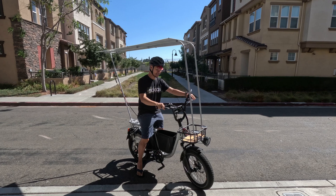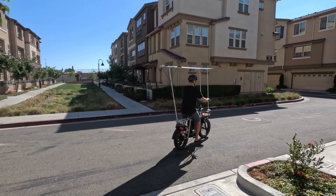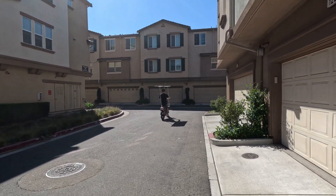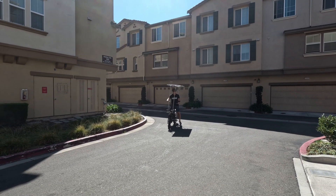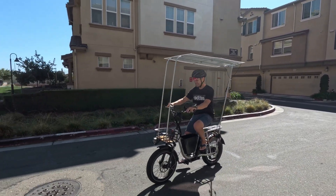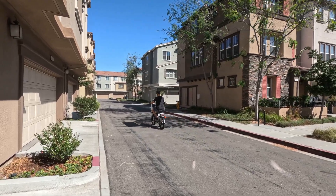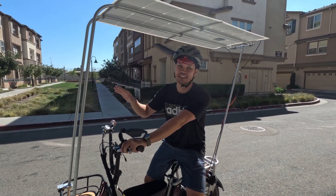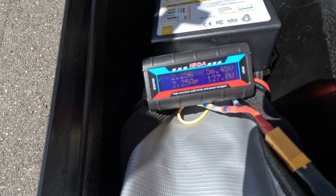It turns on. It's about 2 p.m. right now — voltage is a little low. It's about 3 p.m. now — this is pure electric energy. Let's get a high speed test. That's pretty cool — we got about 6 miles an hour. There's too much shade and trees around, but 6 miles an hour starting from a standstill without any battery is pretty impressive. In peak sunlight I'm getting about 126 watts feeding the battery, but that wasn't enough to ride the bicycle on solar power alone without a battery.